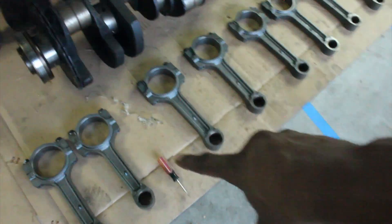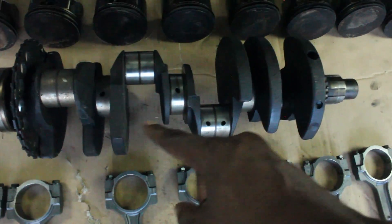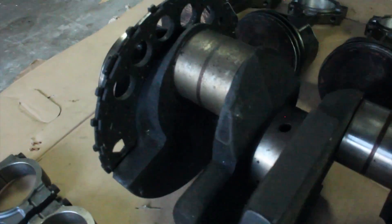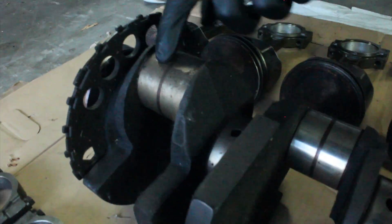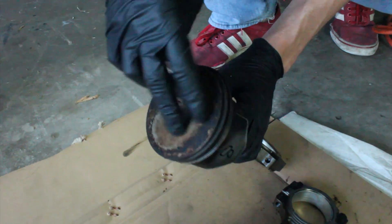What are we going to do today? Today, we're going to clean up the crankshaft. We're going to get the new rods — our 5.3 rods — onto our 4.8 pistons and see what else we get done. That's right, 5.3 rods that will be getting installed with the engine. This is the 5.3 crank. This one we need to clean up. You can probably see how gross it is. We're going to be cleaning the crank up. We're going to be cleaning our flat top 4.8 pistons — the 5.3s have a dish, so that's a dead giveaway.